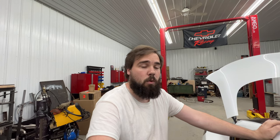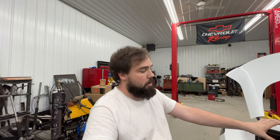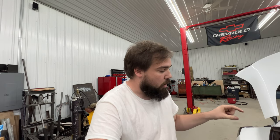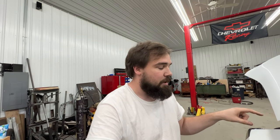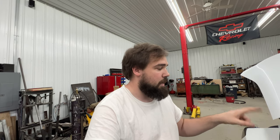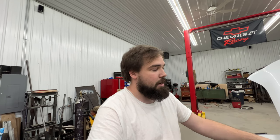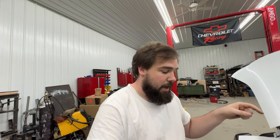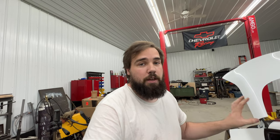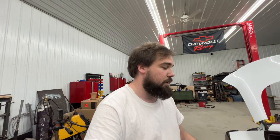I've been working for a little while now. I got the amp rack completely in the car. I just have to put ends on the leads coming from the subwoofer box because I'm gonna have a connector between the subwoofer box and the amplifier. I gotta do the same thing for the input, which is the signal wire coming from the subwoofer on the door, and it comes back here. I'm gonna put connectors on those as well so I can disconnect the amp rack from that signal source. And then I think we'll be ready to pick the seats up and hook the power wire for the amp rack up to the DC to DC converter.